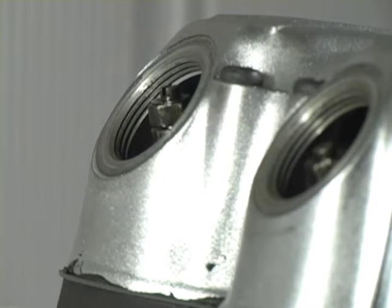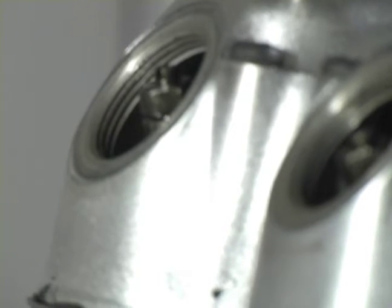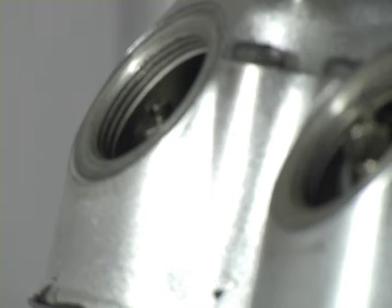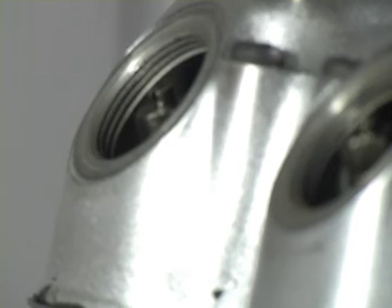Cylinders are measured left to right as one, two, three, four. We're homing in on the intake valve for number one cylinder. I'm going to rotate the engine through at the crankshaft and watch that valve. There it starts to go down — the intake is opening. That's the intake stroke. The piston is moving downward, sucking in the air-fuel charge through the carburetors. Once we get to the bottom, that valve is going to start to close, and the piston comes up on the compression stroke. Once I see that valve starting to close again, I'll shift my attention to the timing marks on the end of the crankshaft.